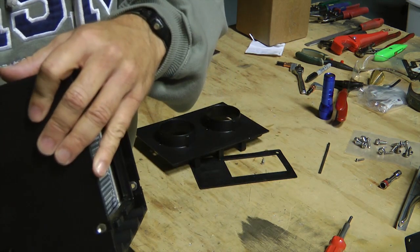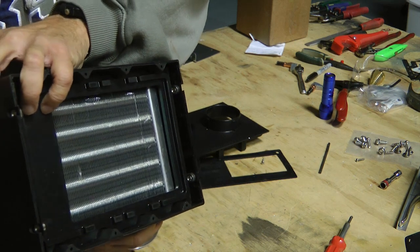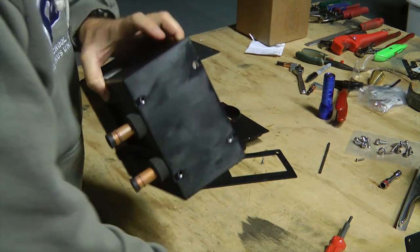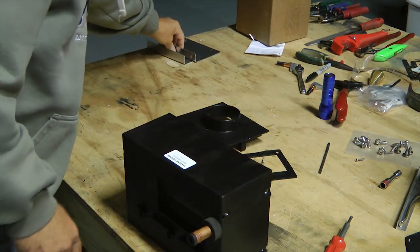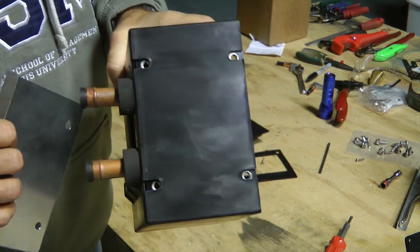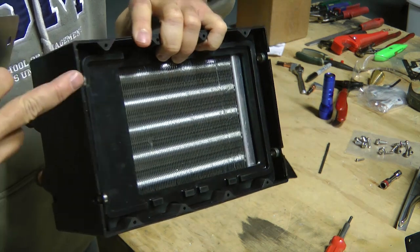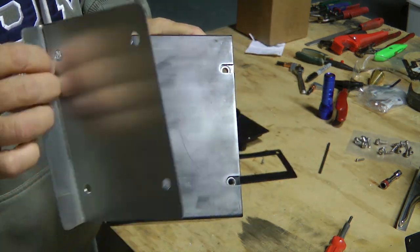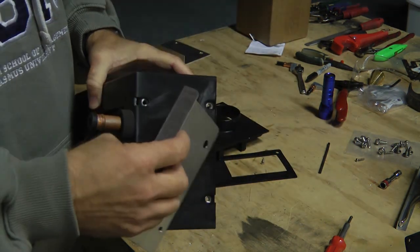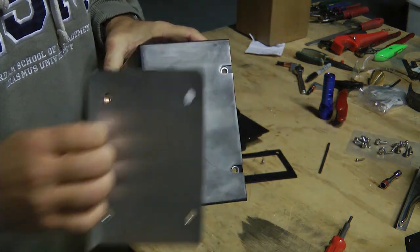This will be directed at the feet of the pilot and co-pilot. I'll make some brackets to attach this to the firewall. In fact, there were already tapped holes in a metal plate on the other side, and I made some simple aluminum brackets which I will bolt in place and then attach to the firewall, one on each side.